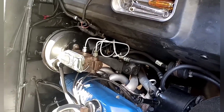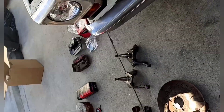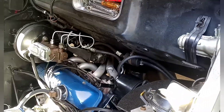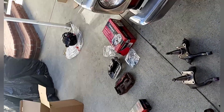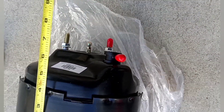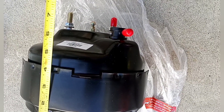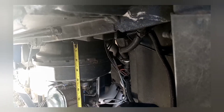You might run into some problems with disc brakes using the drum brake setup. They might work if you use the right proportioning valve, but I don't think they would have half as much pressure as if you use the dual diaphragm and the proper master cylinder. This disc brake master cylinder measures about six and a quarter inches front to back, while the drum brake one measures four inches.